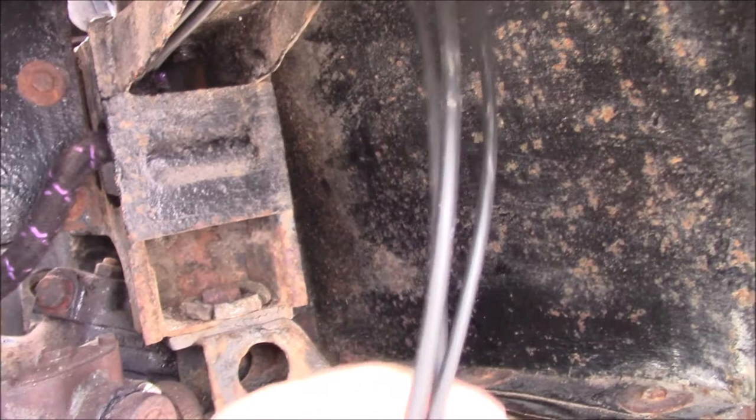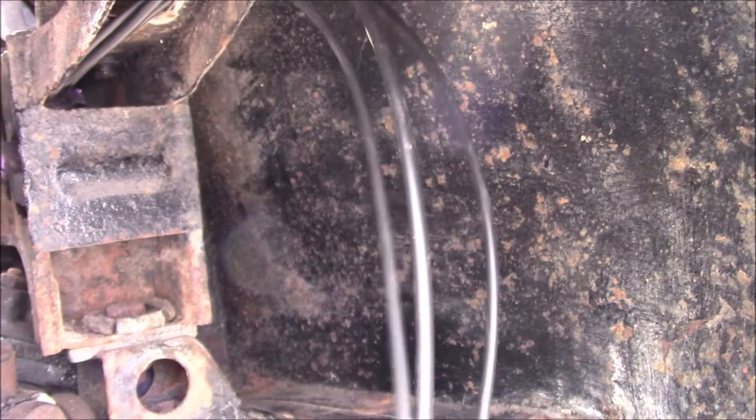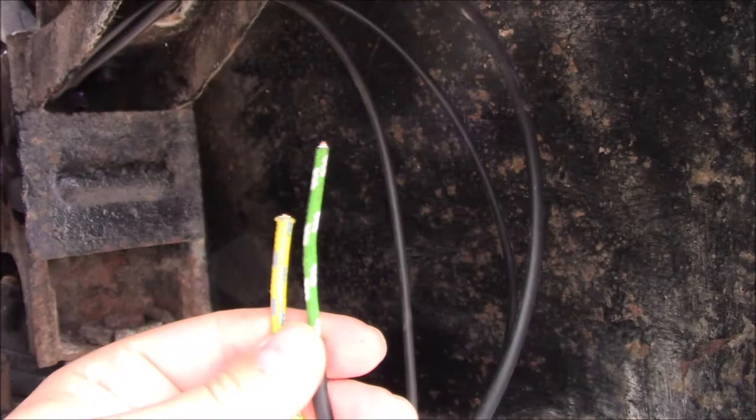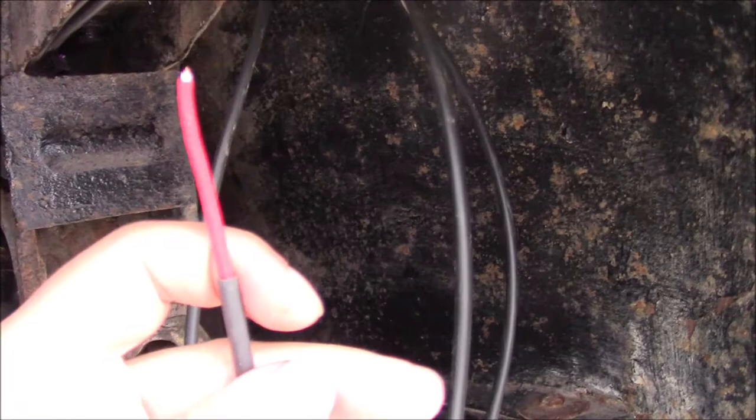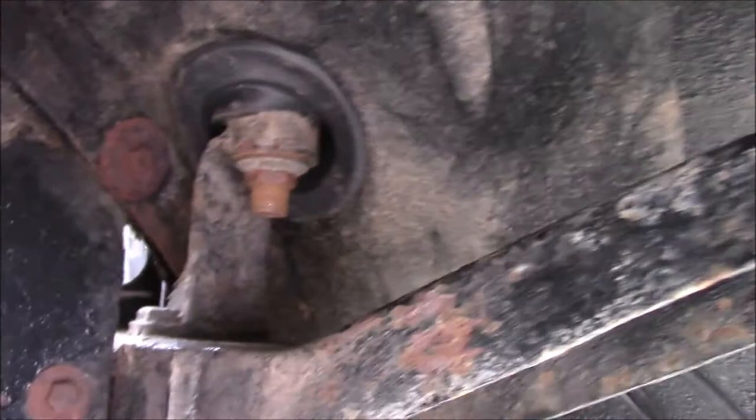I had thought that these wires all went to the headlights, and they don't. What was confusing me here is the rewiring that had been done, and the fact that we've had some of this apart and then not put it back together straight away. A good look through video footage, photographs, and wiring diagrams, and I basically started from scratch mentally. So these two are for the headlights, and this one is for the side lights. I thought this was too short to get to the side lights, but it's not — you can see that's the side light there, and then the headlight portion pops up through in there. These are all ready to be threaded through into their homes.